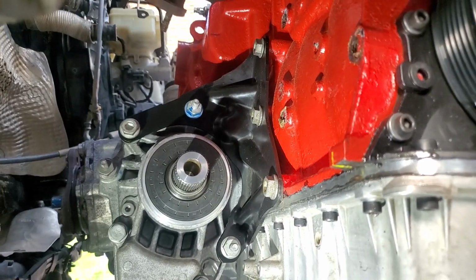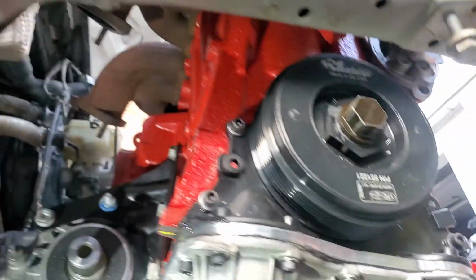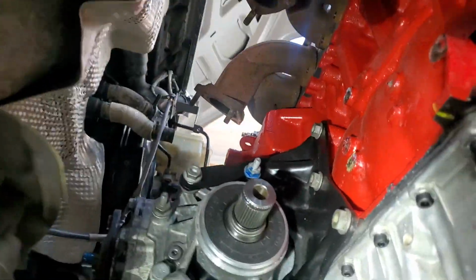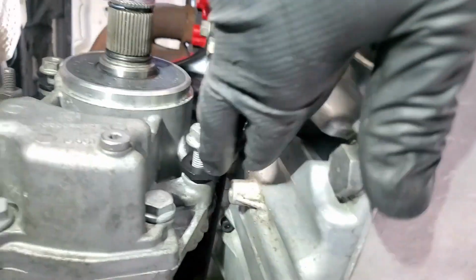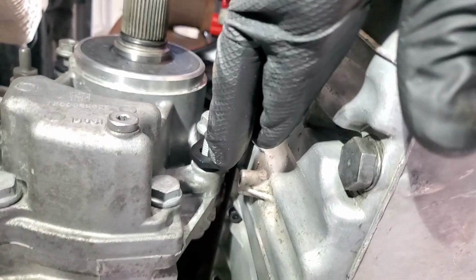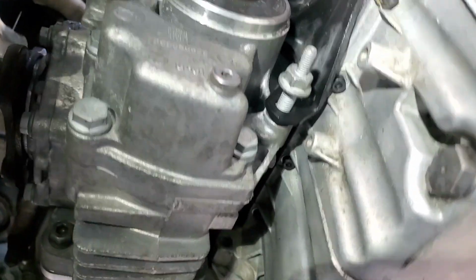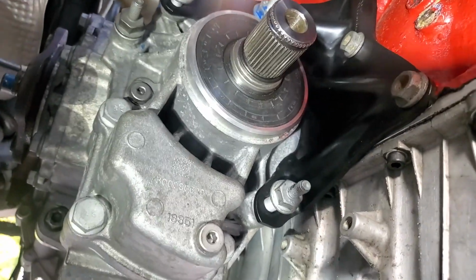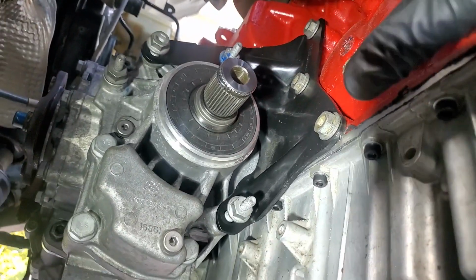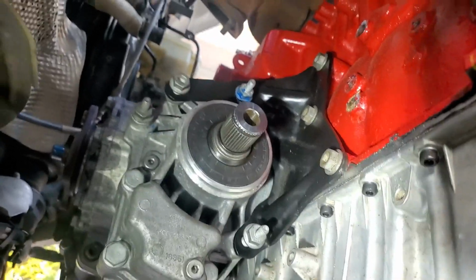But one of the good things about it, as I stated before, is that I have it spaced apart evenly all the way around, and you can see the little gap here. So if I wanted to install a washer as they had before, I can put 3 washers all the way around and just bolt it in position, or I can notch these holes out and butt it up very tight against the transfer case, and then secure 3 grade 12.9 bolts. So I do have the material or room to do that.